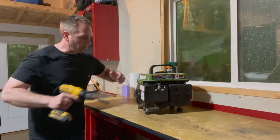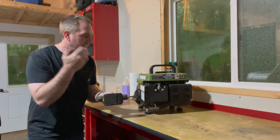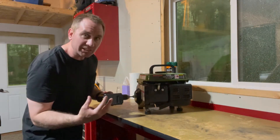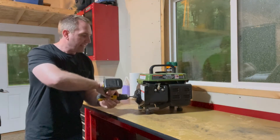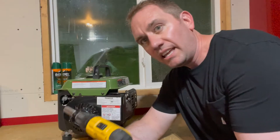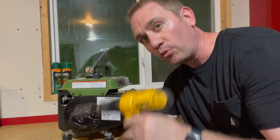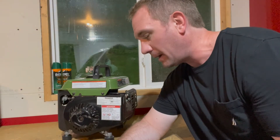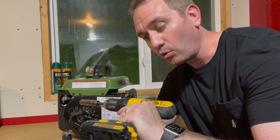The other thing you have to be careful about: when you've got your drill on here and you're holding it to prevent spinning and putting torque in to turn the engine over, eventually when the engine starts firing, it's going to want to go faster than your drill is going. That is going to try to whip the drill around on you, so you need to pull it off rather quickly. The larger your engine is, the greater that risk — the more force it can put into your drill. It can really cause personal harm to you. This thing can whip around and break your wrist. That's an even worse day than breaking off the crank bolt.